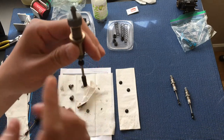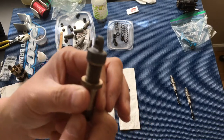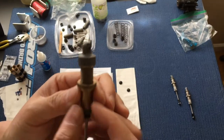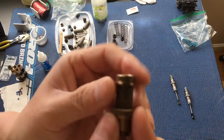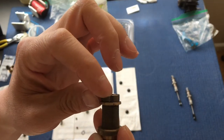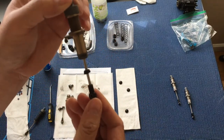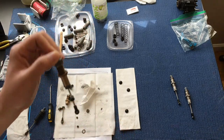We filled it up to the top and screwed the cap on. There's a nice little cutout slot on these shocks — it's right on the threads here — and the excess fluid will actually bleed out of that slot. But with the shock cap fully tightened, we can't compress the shock all the way; it's bottoming out probably less than halfway through its full amount of travel.